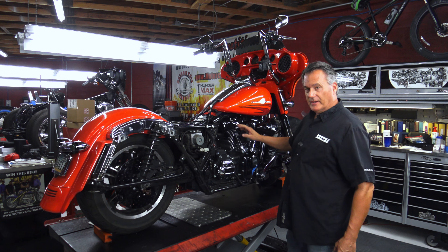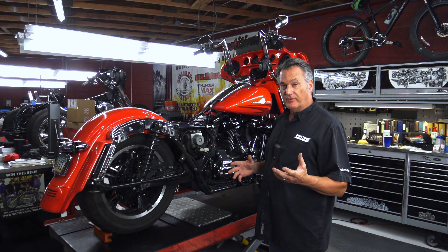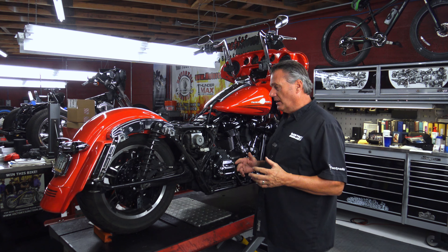Hopefully it's got tappet cuffs and things like that, but I'm not 100% sure. This has come up a bunch of times about the stock plastic tappet cuffs. In stock applications, 100%, I think they're fine — I haven't seen one fail that I can remember. I've had the bolts break, but that's usually when guys are trying to take them out and don't use heat, as I've covered in previous videos. On higher lift cams, though, I'd highly recommend a performance tappet cuff for that extra security. Anyway, it'd make me sleep better at night.